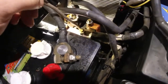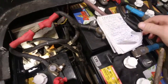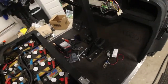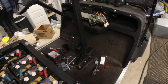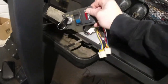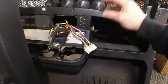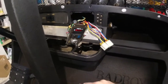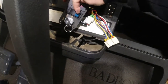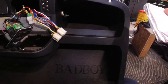I don't know if I'm missing any other fuses — I've pretty much showed you everything I found and could test. I don't see a tow switch. I'm assuming the blue light is the reverse switch. When I did have the relays in and the headlights were working, I still had no solenoid click, the pedal did nothing, the cart didn't move, and the blue light did not light up. The only thing the new relays changed was the headlights and the cigarette lighter.